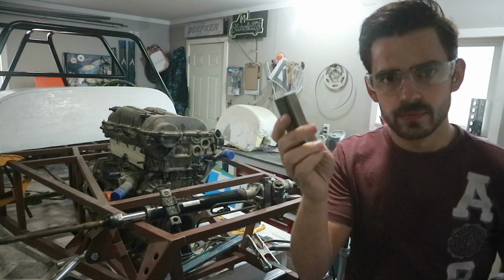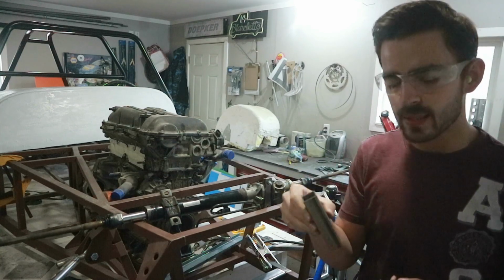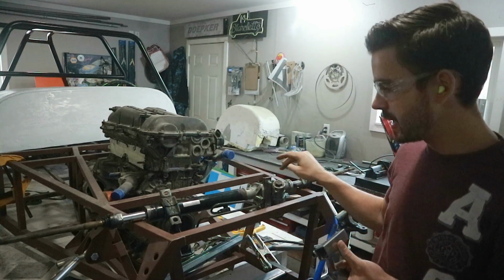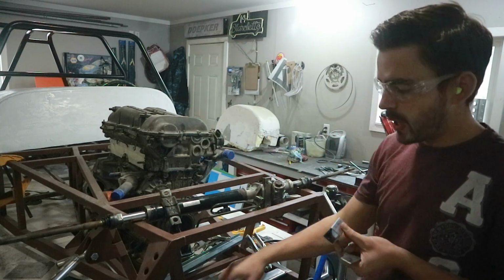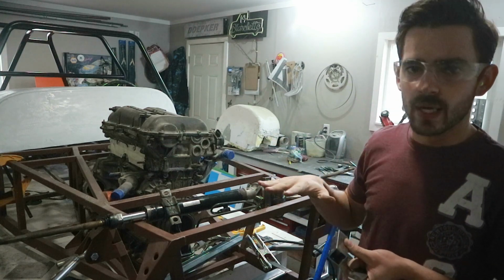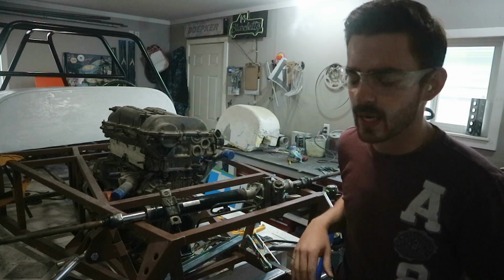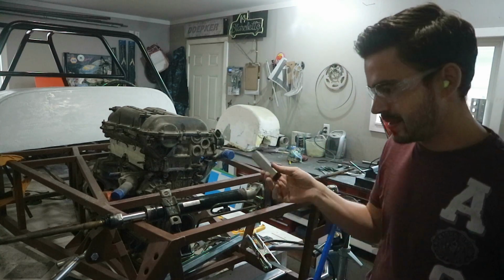So I got some of that 1x1 square tubing. We're gonna cut these and shape them into pedestals that our horseshoes will sit on. And that should space us up from the cross member enough that the housing won't hit. It's gonna raise our steering rack up an inch, but I just tack welded that cross member in, and we can cut those tacks and move that cross member down right to the bottom if we have to. And that'll be able to raise and lower our steering rack. So let's build a couple pedestals to replace these little tabs and then bolt them on.